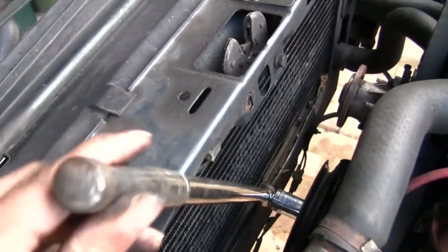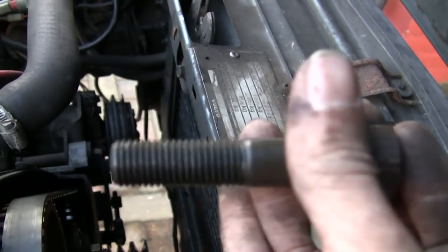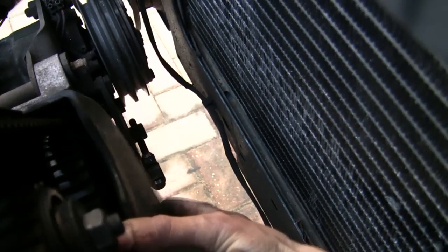I've got my long bar, so now go ahead and we'll see if we can move this bolt. I'm not going to be able to do it one-handed — it's pretty stiff. Now I've got the bolt out. No rust on it at all, it's just very, very tight. We can put that aside. Just very gently it should winkle off the crankshaft — and again, nice and gently because you don't want it flying into the radiator, as it's very, very heavy. Winkle this off — there it goes.